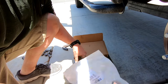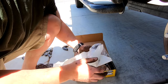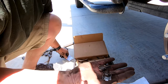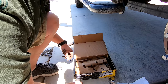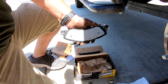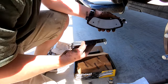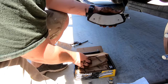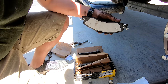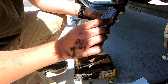Looking through the new box, you can see there's a new set of clips. You should have eight of these — four on each side, four back in the box for the other side. I match them up with my old pads that I pulled out. These are identical on both sides, but if you're doing this on a different year, make, or model, always try to match them up. If you have trouble remembering which side, look on the back and see where the pistons were riding — it'll tell you which goes on the piston side and which goes on the other.